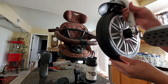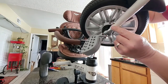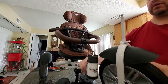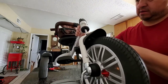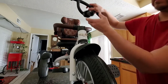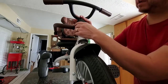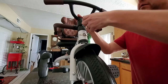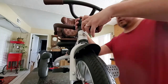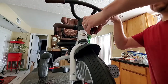If you're wondering which way goes what — you'll see a screw setting here and a bolt setting on this side. The bolt setting will go towards the back, so remember the Phillips screw setting will go towards the front. We're going to pop this right back in. It's actually pretty simple. We're going to pop the handlebar back in — that's pretty easy. Then we're just going to tighten this Allen wrench bolt back up. Just make sure your wheel and your handlebars are aligned right.